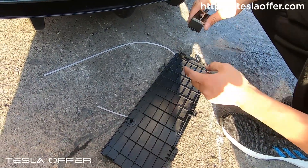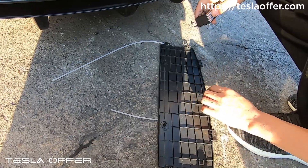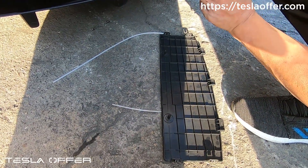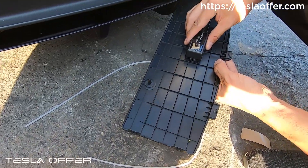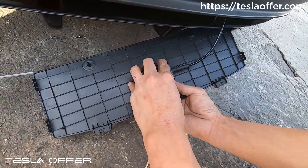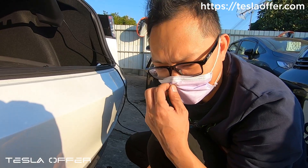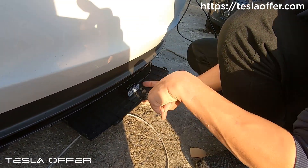Now I can put my foot sensor. I've connected it — just stick this in here. The surface here is not even, so normally it will stick well. But if you worry about it, try to make it flat. Then stick it to around this location. I normally stick it here. One note: the double-sided tape adhesive side always faces down. If you are installing the foot sensor below the bumper, apply double-sided tape on this surface so this side always faces down — otherwise it cannot sense you.